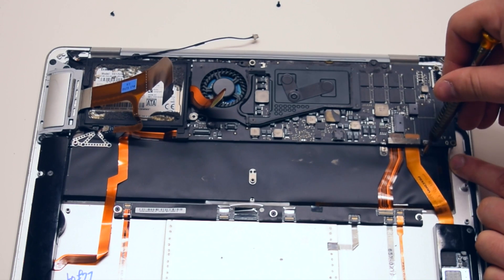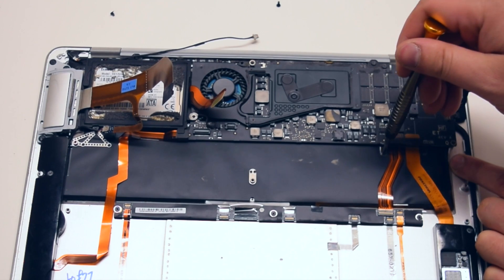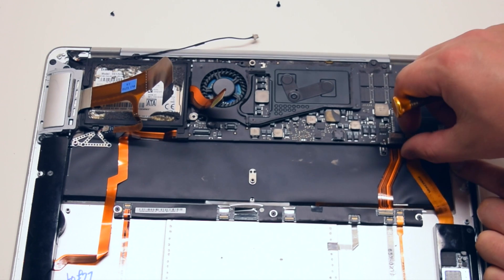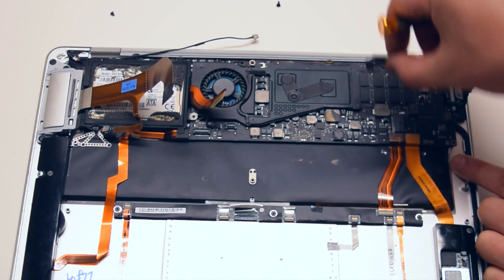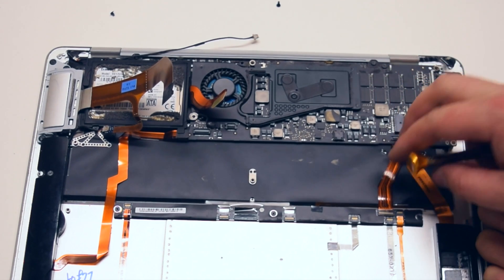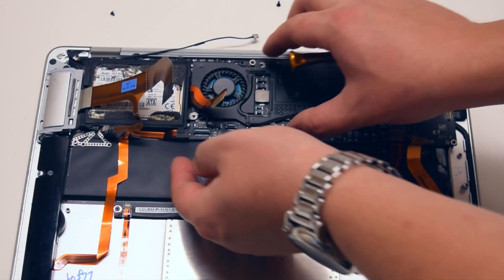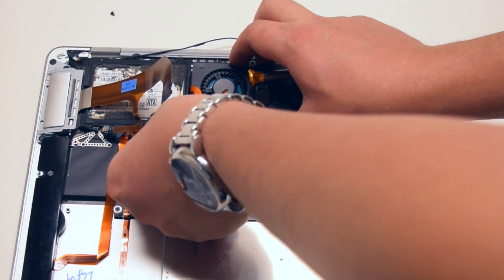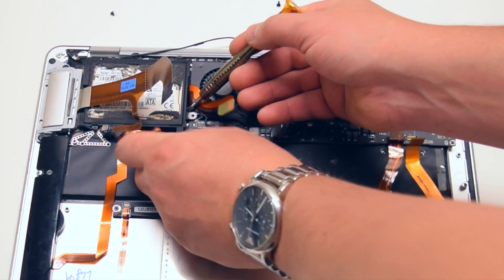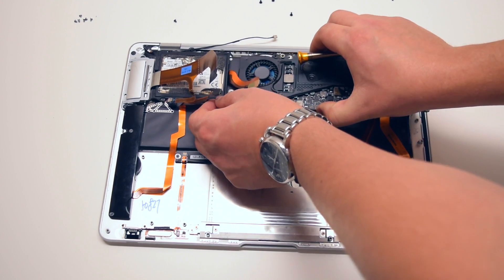The Bluetooth and the keyboard and trackpad have a retainer that's screwed in with two small Phillips head screws. Just turn them three times each, leave them in place, and remove that. Now you can pry out the cable connections. Go ahead and lift up the hard drive bracket slightly and disconnect the sound card. You can now pull out the board.